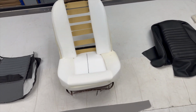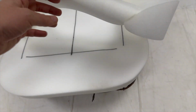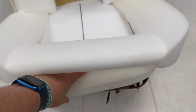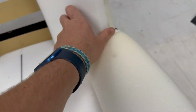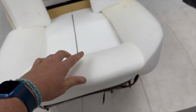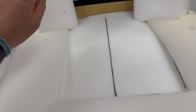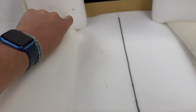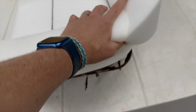Going on to the cushion bases, you've got the main flat foam, which you just lightly glue, anchor in place on the framework there. You kind of shove it up underneath these side bolsters. Then we always say do the sort of center mark on it there, and then get this surround in place again. You're shoving it right underneath these side bolsters there, roughly laying it up to the front there and drawing some lines across just as a guide.